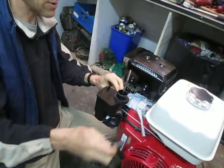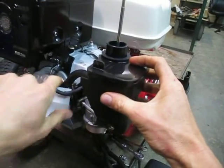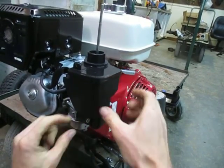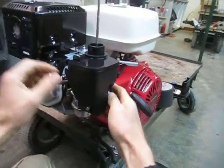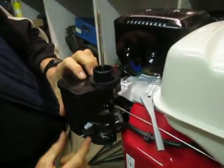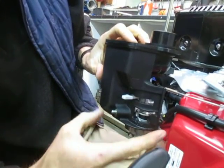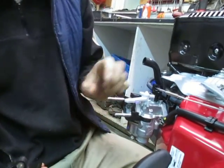Now this thing is loose. There is a breather tube on most of these engines that is connected on the back of the elbow down into the valve cover — we can just pop that off and then this thing slides off. If we're careful, we won't tear the gasket. It's not coming off because I forgot to turn the fuel shutoff to the off position. This fuel shutoff lever has to be swung to off so it actually clears the little door here — if it's in the on position, it hits. So fuel shutoff to off. There's that — we didn't tear the gasket.